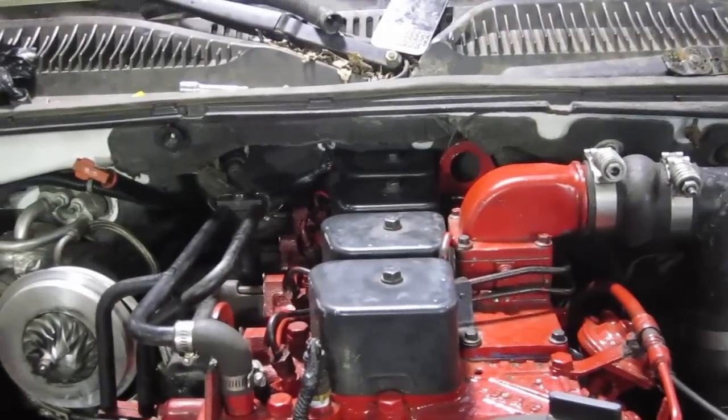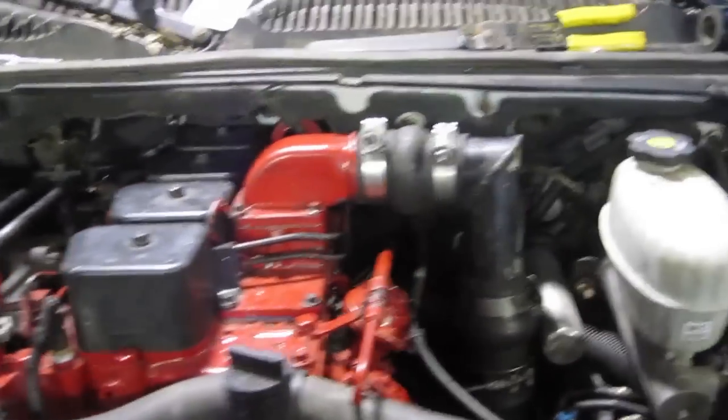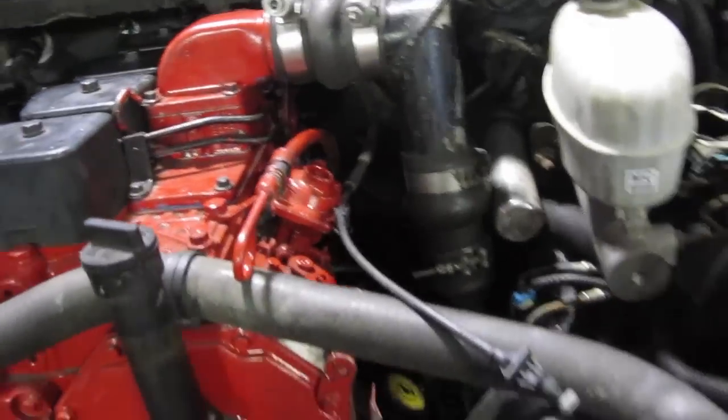Everything else is tucked away nice and neat — all my AC lines in here, everything else tucks along the starter in the back. It's hard to see because it's dark but it is kind of neat. Make sure it doesn't hit the exhaust. There's one ground that affects the whole truck, so make sure when you take it apart that you put all the grounds back on again — that'll give you a lot less headaches at the end. Here are the two wires popping out; we're gonna put the relays in with that green ground to turn the fans on.